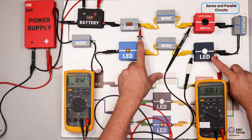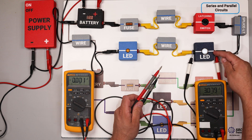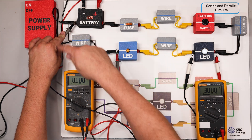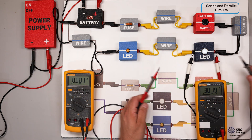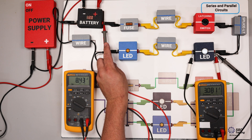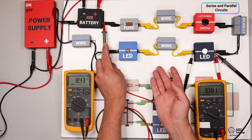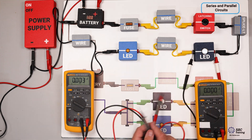On a vehicle, I would first check the ground side of the circuit — red lead closest to battery positive, black lead to ground — to eliminate that side. Then I'd check the positive side: black meter lead here and red meter lead all the way back to the positive battery terminal. This tells me whether my fault is on the positive side or ground side. Don't forget to also test the wire connecting sections together with a voltage drop test.